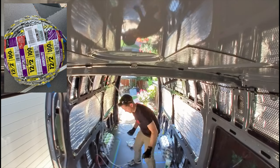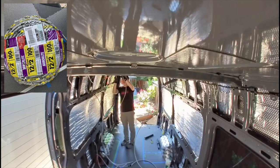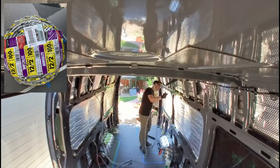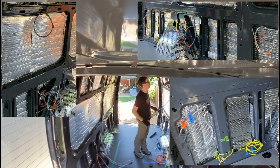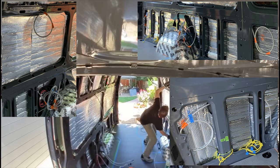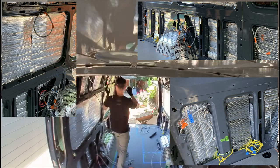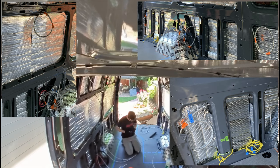When I came across this metal clad, it seemed to have a nice mixture of everything. If you get the metal clad with the wire already in it, it's actually a very, very small diameter for what you get, and you get all the other protections. Metal clad is used in construction for difficult to wire locations or high moisture areas, and it can even be exposed. So this really fits the bill for what I was looking for, and it was easy to use.